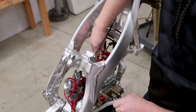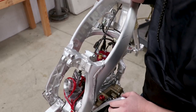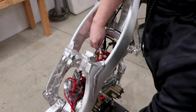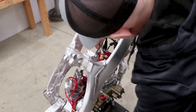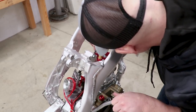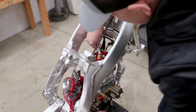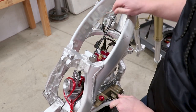There's really nothing else to test — I've gone through all the components and checked everything, and everything seems to be good. This is the moment of truth. I've got a spark plug in there, grounded on the head, and I'm going to kick this thing over by hand as fast as I can. Are you kidding me? This thing has spark! What could it have been? Was it that grease? Yeah, it does have spark — so it must have been the grease.